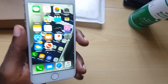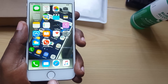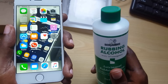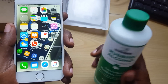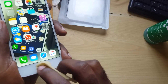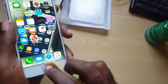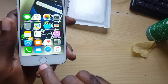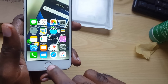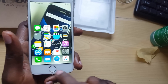One of the main reasons the home button stops working is that grime and grease build up from repeated touching. To fix this, get some isopropyl alcohol or regular rubbing alcohol — be careful it doesn't get into anything. Wet a piece of microfiber cloth or cotton and clean the button using the alcohol. This removes the grime and cleans the sensor. You can also nudge the button around all four corners repeatedly, as sometimes it gets stuck.